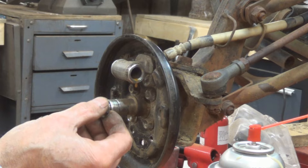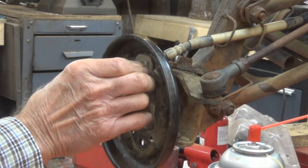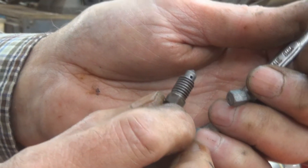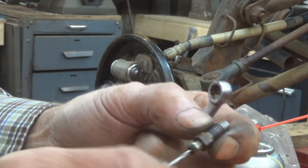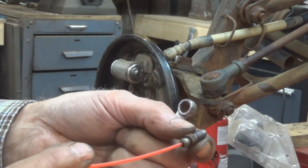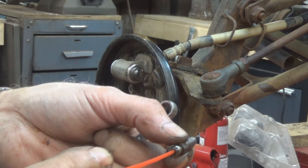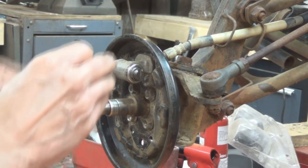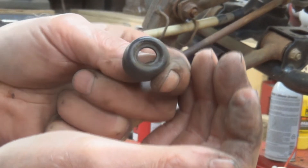We've cleaned out the inside, so now we're putting our cleaned-up piston back in just like that. The bleeder wasn't working the best, so sometimes you have to take a drill bit and run it down through the inside to get the junk out — that's what we did on this one. Then we take the brake cleaner, point the nozzle away from the camera, and you can see it coming out the side, so we know it's clear and we're good to go.